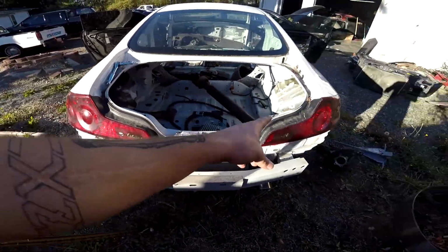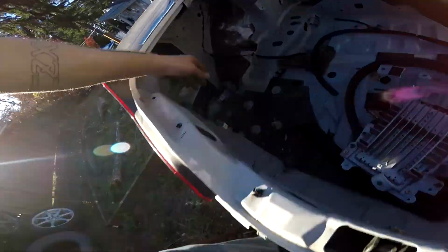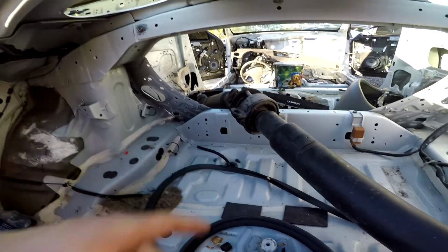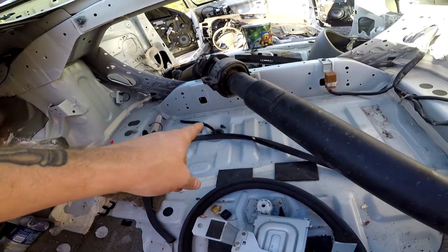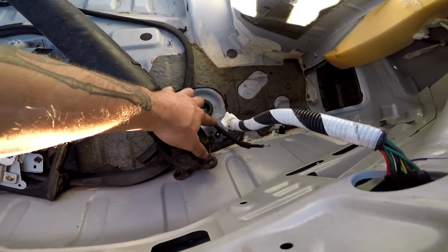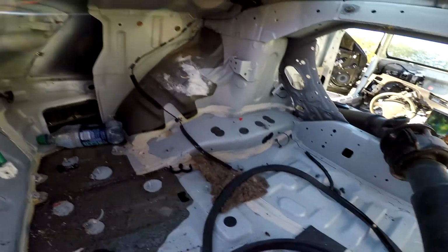So now that I've figured out what I'm going to do for the day, basically gonna go through, pigtail everything, and get rid of the main wiring harness that I don't need. So taillights are already pigtailed. They get a nice connector here. Fuel, I don't know what all these are, so until I figure out what they are, the wire's coming out there, and the wire coming out right here. Until I figure out what those are, I'm gonna leave a pigtail for those.